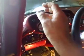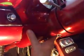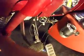Put your rag joint on. Make sure the rag joints are loose on both sides so it just slides on there. You can tighten it up after you get it on. You get the steering column out, you undo this bolt, this cover will come down. Alright, under this you've got 2 other things that hold the steering column in. This here,